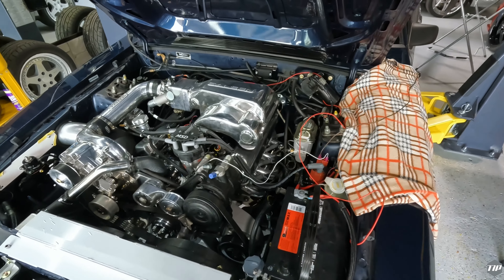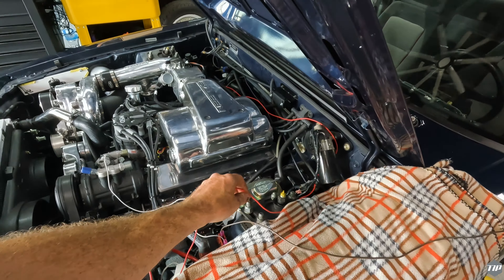That's pretty much it for wiring up the Terminator X. I double-checked: the Aeromotive 340 Stealth fuel pump draws a maximum of 15 amps at 13.5 volts at 60 psi, so we're more than good for the supplied relay that comes off the Terminator X kit. I don't have the TFI connector plugged into the distributor yet because the distributor is coming out so we can prime the oil pump. The white wire goes to the negative side of the coil. We have 12 volts to the relay for the fuel pump.